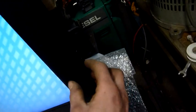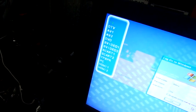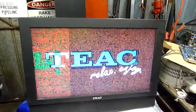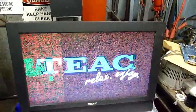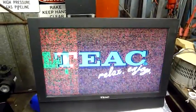I've got the remote for it as well. DVD is not plugged in at the moment. The digital TV tuner won't have anything so there's no signal — yeah, it's trying to find a channel. There we go — that's what happens when it gets a full-size image. It's not just ghosting on the red, it's also on the green. If I play back a DVD that's what it'll look like. The panel just seems to be fine — you look at the on-screen display and there's no ghosting, but as soon as I get a proper image going through the analog signal converter it just plays up.